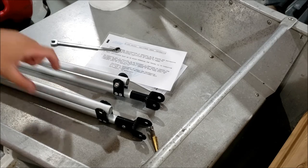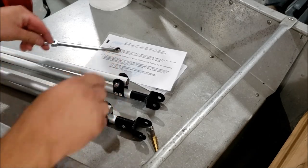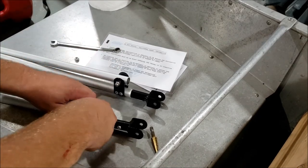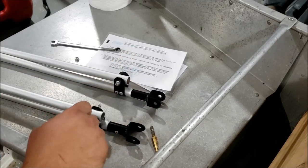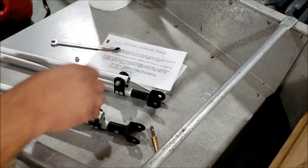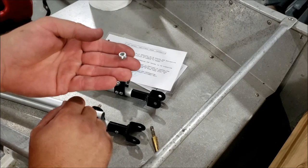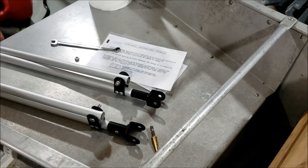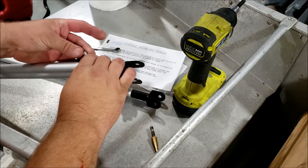Now, should I have checked the nut tightness beforehand? Probably. However, I did actually on one, because the little acorn nut, it bottoms out. I mean, you could argue, should have put in some Loctite or maybe ran a weld bead from the inside to make sure it didn't back out, but come on. Ain't nobody doing that. So I picked up some of these metric, I think it's an M6-1 lock nut. And I put those on there instead of the acorn nuts, and that should solve the problem of it falling apart.